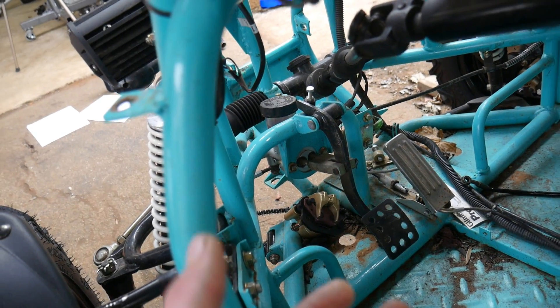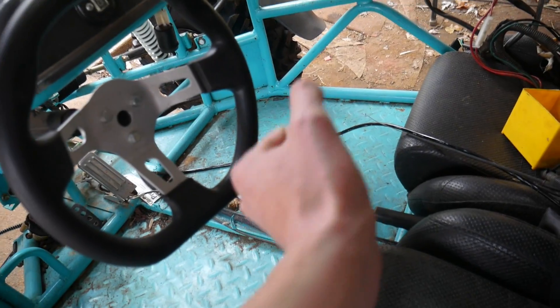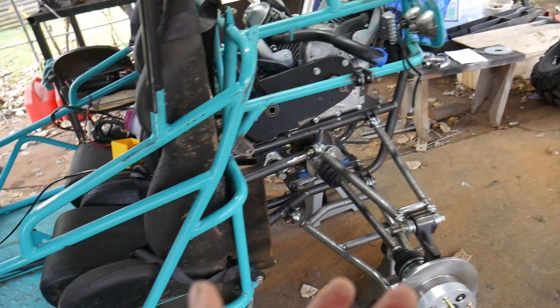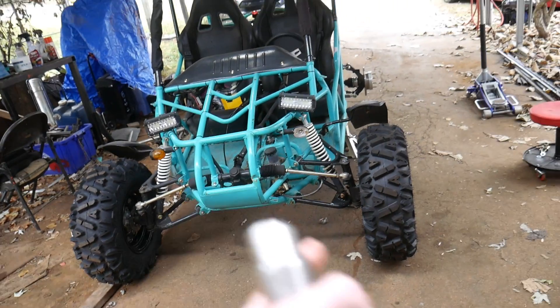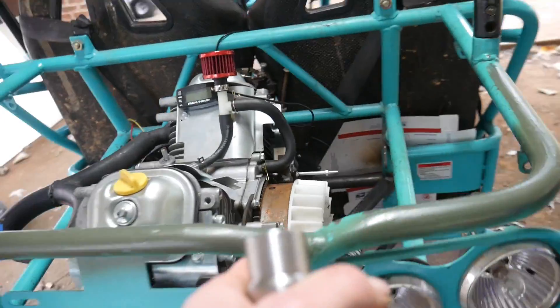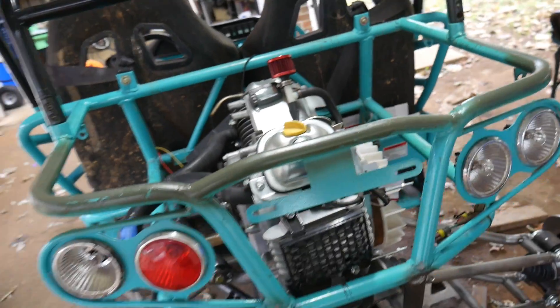I'm going to stop this episode here. I need to order some coil over shocks and some new wheels. I'm also concerned with this master cylinder — whether it will have the capacity to push all four of these brakes. What I want to do is set up a drift lever or hydro e-brake and just hook up the two rear brakes to that. Either way, the brakes on this thing will not be a slouch. In the next video, I want to get started on the front suspension, probably changing it over to Heims, extending it a little bit, upgrading the front brakes — Moto Mule cut out some rotors for me. Also new wheels, new shocks, a billet flywheel, billet rods, redo the exhaust and intake manifold. Lots of stuff coming.